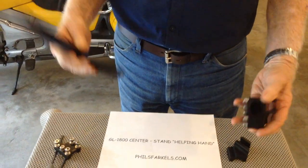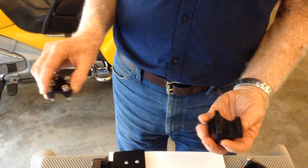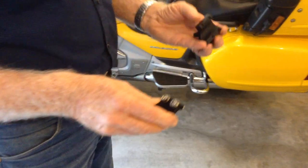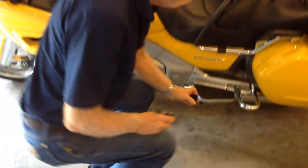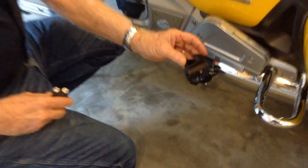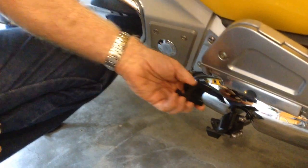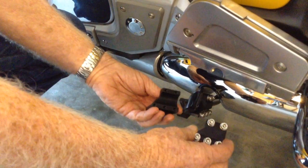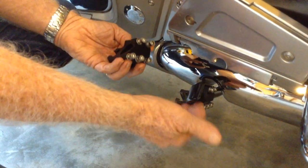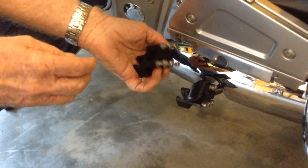All of the parts are anodized black aluminum. The bracket is the only part that you have to do any installation on. It takes one 5mm Allen wrench. These parts straddle the stock center stand arm. The large part with the T-slot goes in the front with the two holes at the top, and the saddle clamp attaches from the rear, sliding it out as far as it will go under the foot pad. Torque all 5 bolts to the same tension and make sure they are tight.